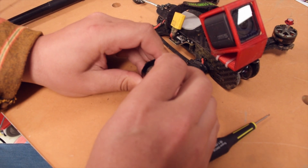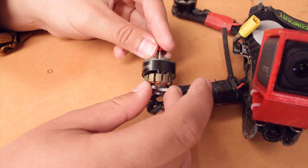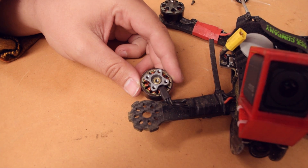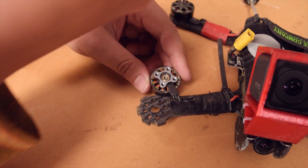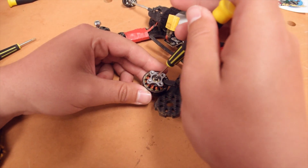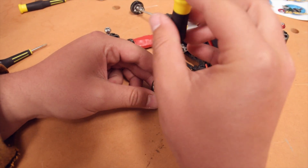These magnets are strong, so be careful here — you might jam your fingers. Let me chuck the washer back on, grab the screw. You can put more thread lock on if you want to, but I don't have any on hand right now, so I'm just going to whip it back in there. You just screw it in, and then when it starts getting tight again, you want to bring it back out just to kind of even out the thread lock.